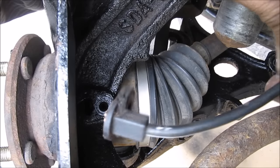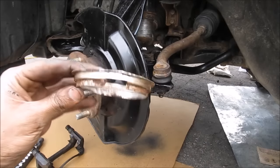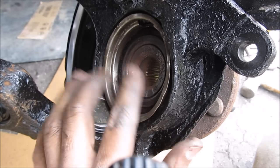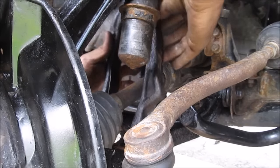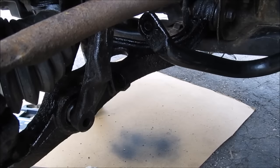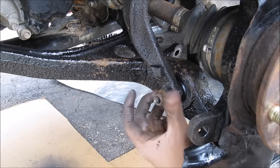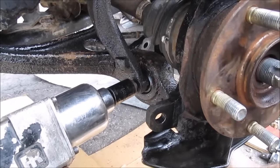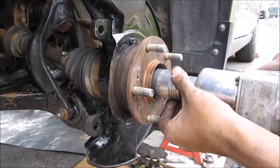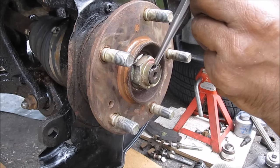Replace the 10mm bolt that holds the ABS line to the knuckle. I just realized that I left the ABS ring out and assembled the whole thing already — so make sure you're not like me and replace this ring before putting everything back together. Next replace the suspension fork if you had to remove it, reinstall the pinch bolt into the suspension fork, and install the lower 17mm bolt that goes through the bushing. Replace the 17mm bolt for the lower suspension fork and tighten this up. Then put in the axle nut and tighten that up. Using a hammer and a punch, punch a little dimple to lock the axle nut in.